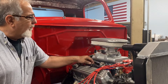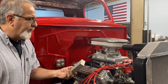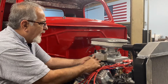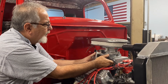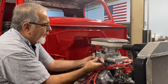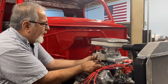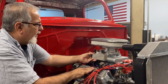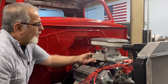I'm going to work on the mount for the ignition module next — it's going to be a heat sink. I've got some in my scrap bin: inch-and-a-quarter by two by about six-inch-long aluminum bar stock. I'm going to mount it to the side of the intake plenum, drill and tap some mounting holes for the module. Where the module is, it's got an area in the back that has to transfer heat, but the rest I'm going to cut cooling fins into to help dissipate that heat. I'm going to mount it parallel with the engine itself and not with the carb base, because that is at an angle.